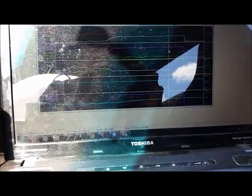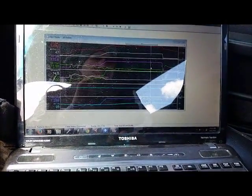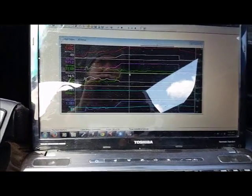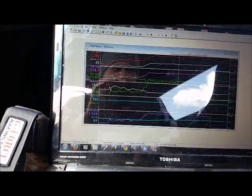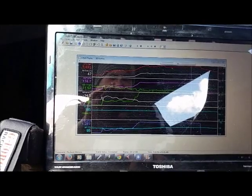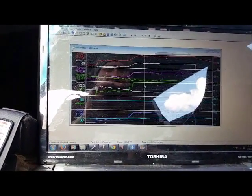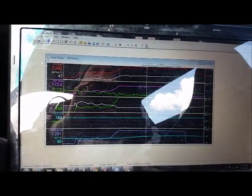Alright, so watching the data log back here, my dirty screen, it appears that I averaged around 175 kPa to 178. That's about 10.8 to 11.3 psi. So an average of 11 psi was all that pass was. Air fuel ratios, for the most part, a little rich, somewhere between 11.3 and 11.7 the whole way. Right about where you want it. Torque converter seems to be good. You see that on the shifts it drops down about 700 RPM.